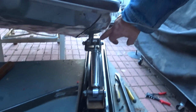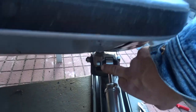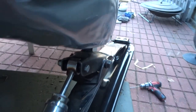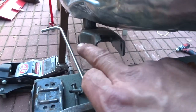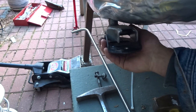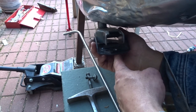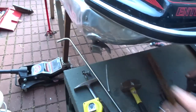This is the proper left shackle, and you can see it narrows on that side and it's straight on this side. On the other side it's narrowed when it should be on this side. So when this was mounted this way, the spring actually sat over here — that meant the ski was actually inside, and that's why it kept rolling on that side all the time. So we're going to try to fix it. Jerry style — jerry rigging it.